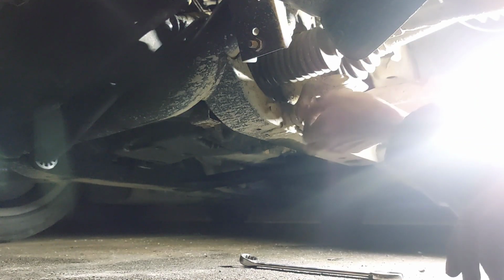I fuck with Louis. But like I said, I anti-seize a lot of my bolts. If you anti-seize your bolts, you don't have to worry about struggling with these. Now, also make sure you torque these, because if you don't torque them with the anti-seize on it, there's a high chance, if you got poly mounts like I do on this side, they may vibrate their way out. Or if someone doesn't like you, they'll take them out. One of the two. Don't make it easy for them.